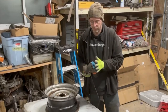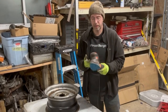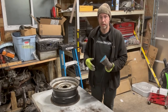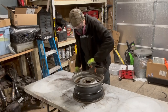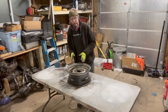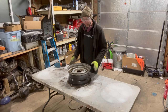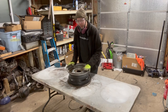I'll use a couple different types of grinders and sanders. This is an inexpensive warrior palm sander from Harbor Freight — about 20 bucks — and it's actually serving pretty well. With the diamond shape or pointed tip you can get into grooves and areas you can't reach with other types of sanders. This is only going to be so effective, then I'll use air tools and a larger grinder for the back. Use the sander to get the lip and all the areas where the tire sits. The biggest thing to remember: you're just getting the junk off. You're not trying to sand into the body of the wheel — you don't want to deform or damage it. So don't go too crazy. Take a look as you go, and if it looks like you're taking too much out, back off and use a lighter grit.